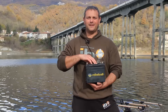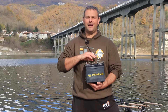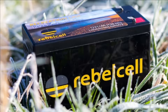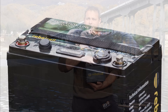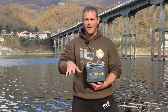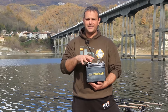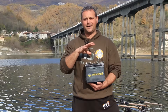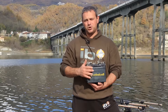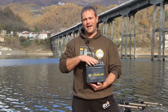Here I am alone at last with my Rebel Cell. In this test I am showing you the version of 12 volts and 50 ampere. But there are other versions available: we have a 25 ampere model, one of 11 ampere, and a latest new entry of 100 ampere. To specify: the 25 ampere corresponds to a 55 ampere AGM or gel, the 11 ampere to 20 ampere AGM or gel, and 100 ampere to a monstrous 200 ampere AGM or gel — which has a weight of 50 kilograms, compared to just 10 kilograms for the Rebel Cell.